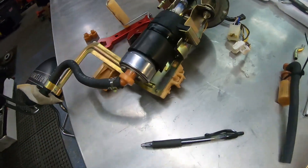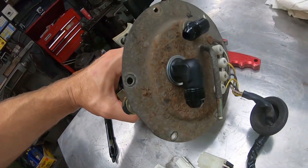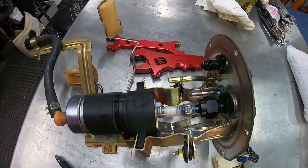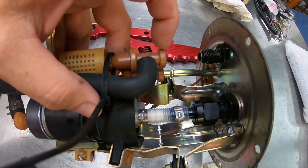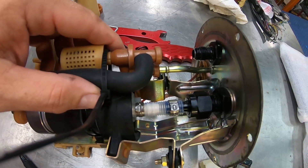I've got a little tech video for you today. We're working on a fuel sending unit for a 1990 Nissan 300ZX two-seater. It's important that it's a two-seater because two-seater 300ZXs have what's commonly referred to as a saddle tank. The fuel tank itself is ahead of the rear subframe behind the front seats, and it's called a saddle tank because the shape of the tank kind of looks like a horse's saddle because it has to pass over top of the drive shaft.